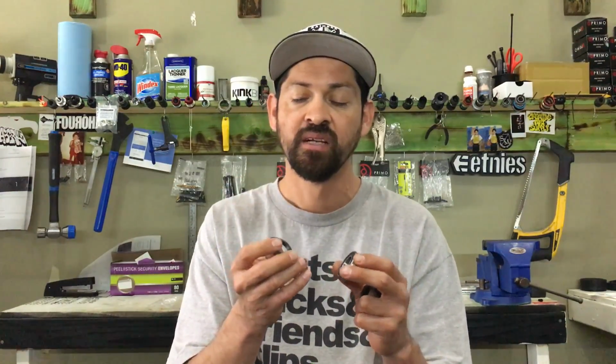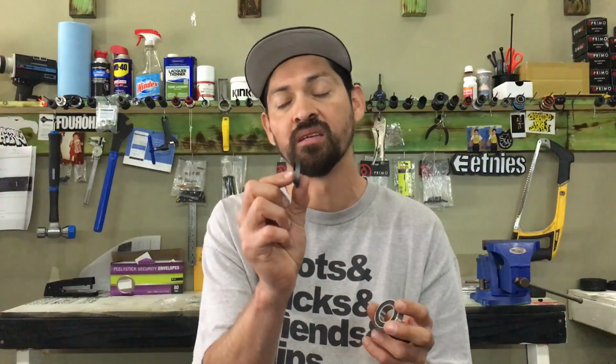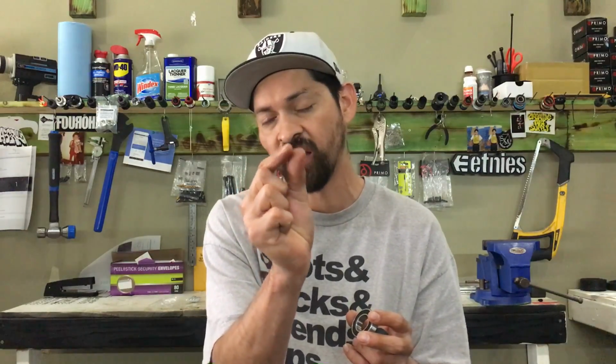So to be honest with you, if you're riding a 24 millimeter spindle crank and the sprocket just slides right on, then most likely you do need this. But if you're the 99.9% of the other people that have a sprocket, a hat washer, and then they put this cone on, you probably don't need this cone. You probably just need a really, really thin wafer washer in between there in order to have that chain alignment lined up. A lot of people don't see this, but it really does happen and it really is affecting your bike, even though you're stubborn and you don't think it is.